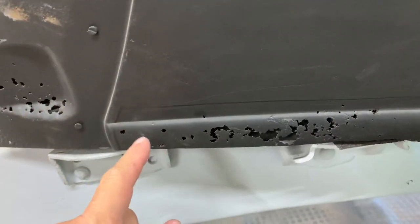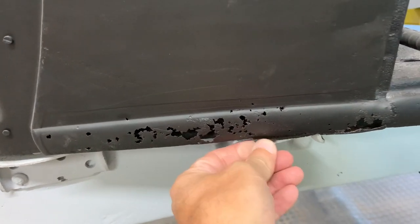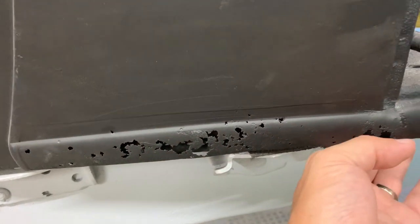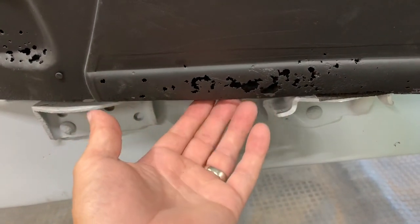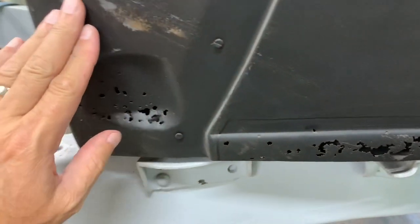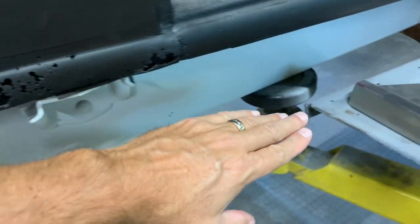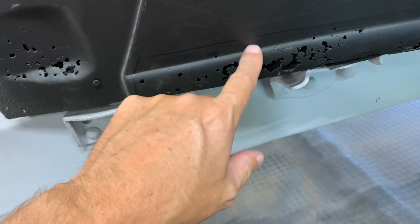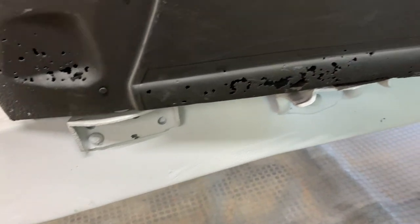I'm going to have to cut it up a little higher. I'll cut this out and put it all back up on the frame. The curving underneath is going to interfere with the mounts — that's okay, I'll put my stand under here and lift it up a little bit, then tack it in. I can finish the weld next time I flip it over. Right now I want to see if I can get this to fit right, because the fender comes down here to the running board, and this curvature has got to be right so it fits correctly.